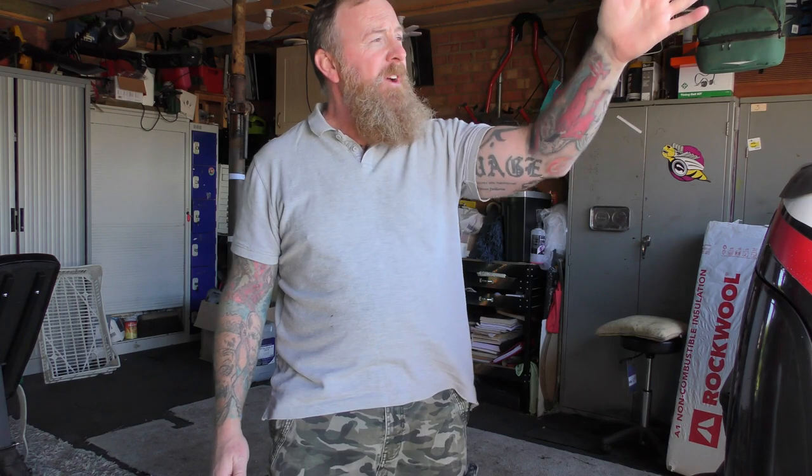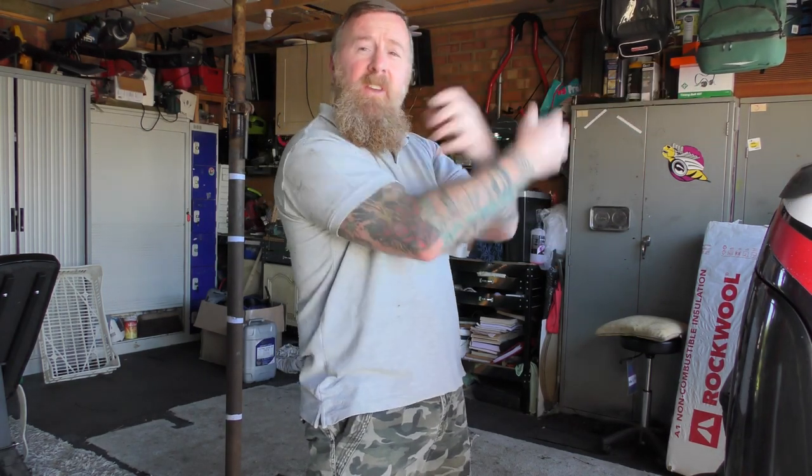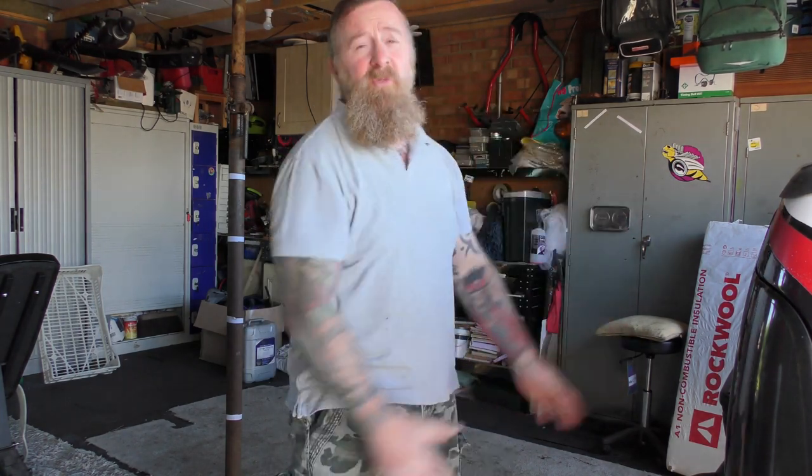I've got to do a proper look around, yes I know it's got stickers, that's coming up, but I had to talk this out first. I'm a bit funny with tyres — I like them all matching, same brand at least. It's found that on this side it's 235 by 85 by 16 — they're just transit wheels — front, front, back, back, all the same. But this side, no: 265 by 75. So I'm gonna — can't afford it yet — take these two 265 by 75 tyres off and put them on front, and then the whole back axle will at least be 235 by 85 by 16. That'd be better. And then when I get the money I'll make sure they're all the same brand.